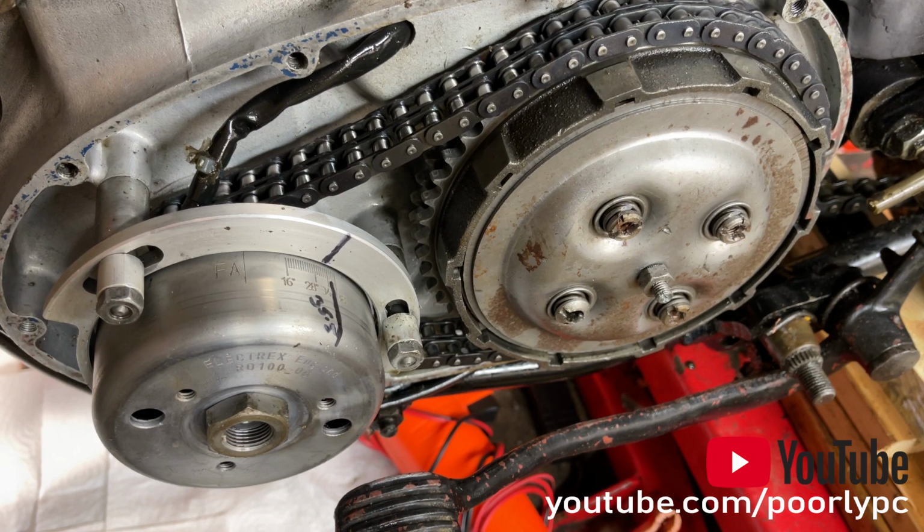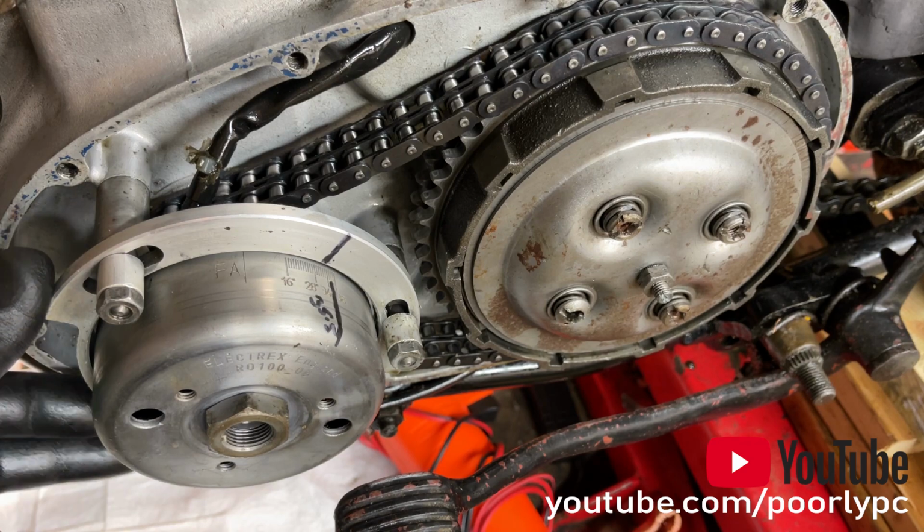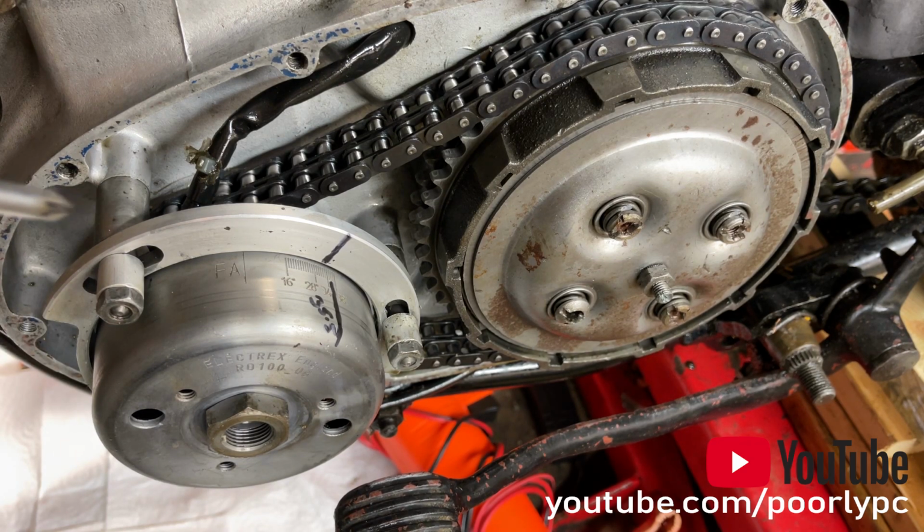So with two options, the easiest option is to undo the three nuts and rotate on the slotted keyway for the lines to align. If using their tapered collet method, you find that you've got top dead center and there isn't enough adjustment here, you have to undo this screw and remove the rotor and re-put it in so that hopefully it's within that tolerance of adjustment.